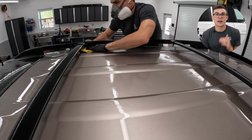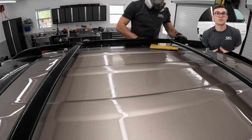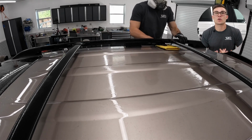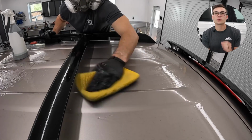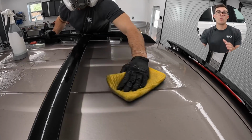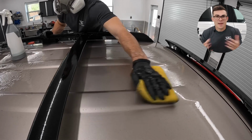Now, I mentioned just a second ago that I buy it in 2 different ways. Number one, there is a gallon concentrate available that's just the liquid. And number two, there are aerosol cans available of Citral as well. In a situation like this, I am always reaching for my concentrate gallon. Okay, so I want the liquid. I put it in my pump sprayer. I dilute it a little bit with water to increase its spreadability, and then I just let it sit on the paint.